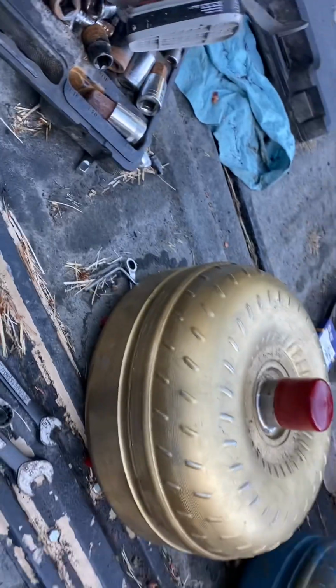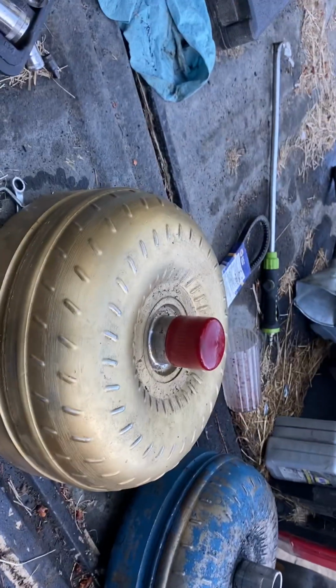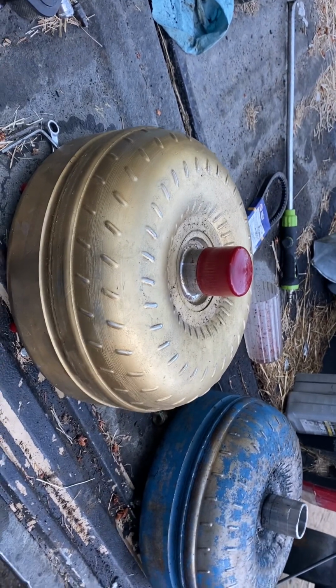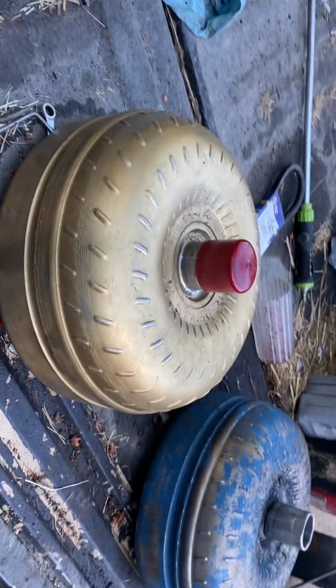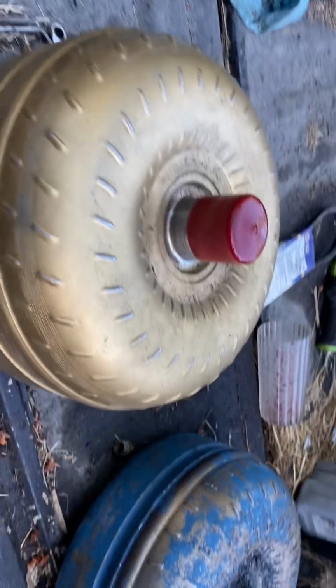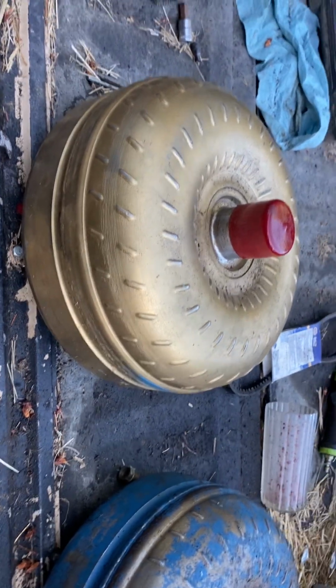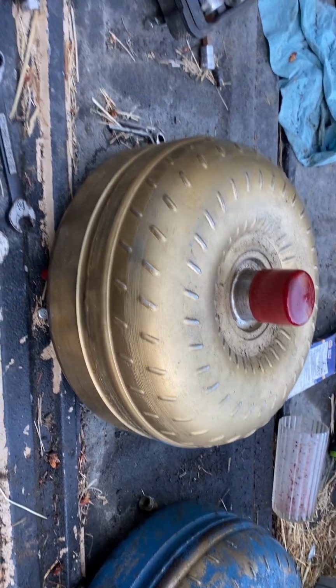They're both 7.3 diesels, but these two things don't cross over, and you can't take the flex plate off the Power Stroke and put it onto the IDI because the engine balance is different. So they have been literal months without replacing this, or even really having any reasonable communication. So pretty disgusting. Brian's transmission's been ready to pop back in for 2 months.